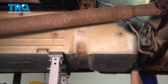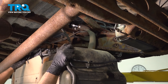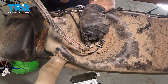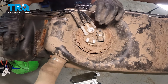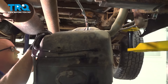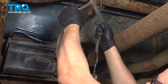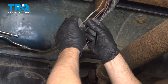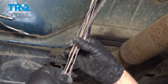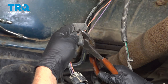Just make sure the filler neck goes over the frame and come down some more. I'll disconnect the connector right here — push this lock back, and then you can push down on the tab. Slide that connector back and slowly drop the tank more. I'll take the wiring harness and just pull back on the insulation. You can see where this one has already been replaced at one time — I'll just show you how to do it again. It's a good idea to stagger the wire connectors. This thicker wire is on the end, so we'll cut that one right there.